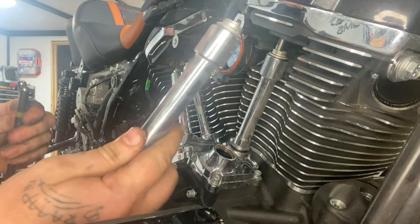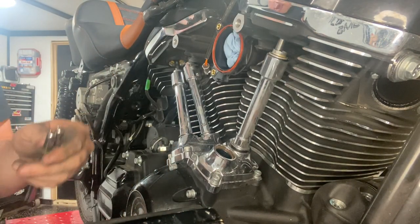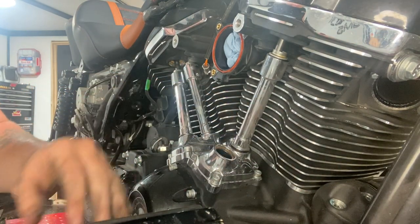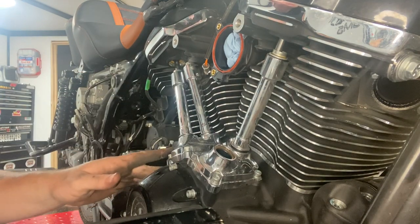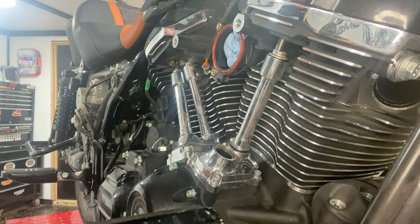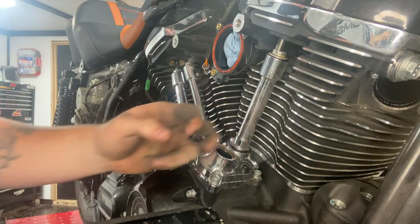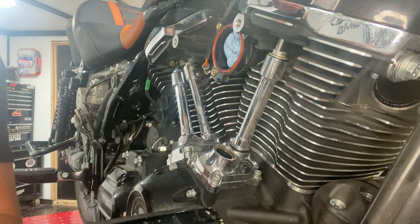And the tubes, like I said, we're keeping the tubes. We were using those. And like I said, we're going to use bolt cutters. You don't ever want to use a grinder or a Sawzall. You don't want to get a bunch of metal shavings down in your lower engine case. You're probably never going to get them all back out, and when I go through the oil system, it's going to be a rough day. So now we're just going to go ahead and cut the other front one. And then we're going to find the overlap again and cut the rear ones.